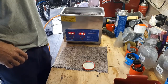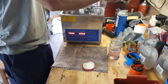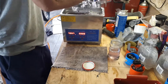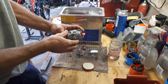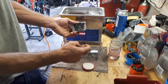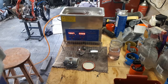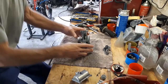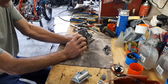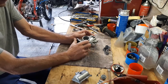Right, so that's another 20 minutes done. Just pulling the stuff out. Yeah, that's all come up pretty good — I'm going to give all this a good rinse with water and a bit of compressed air to make sure everything's nice and clean. In the meantime I'll chuck the body of the carb in there to get that done as well. After putting it in the ultrasonic cleaner and blowing out all the air passageways, it's come up as clean as I've ever seen a carby. Now we'll go ahead and stick it all back together.